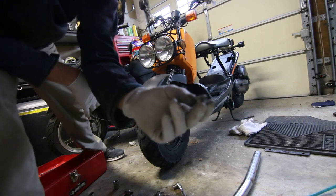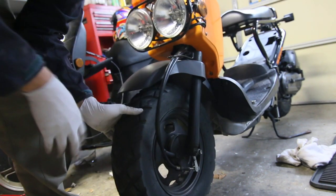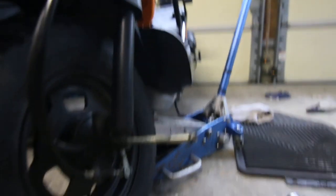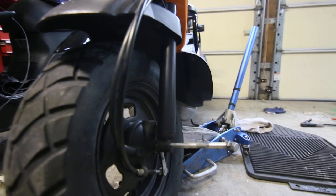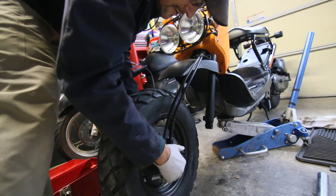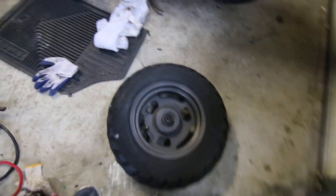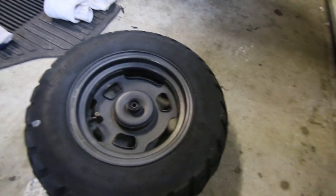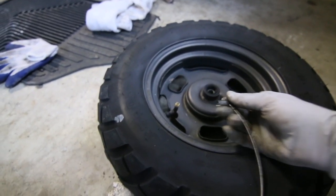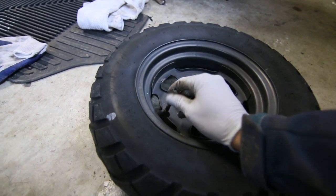That nut is out from the right side of the bike. Since I've never removed a wheel on a scooter before, I put a jack underneath the Ruckus to lift the front wheel — it's a really tiny axle. It just slides right out, easy. Changing tires is all about technique and I hate doing them, but a scooter tire should be a little easier. The tire is worn and cupped up. I remove the valve stem and all the air gushes out.